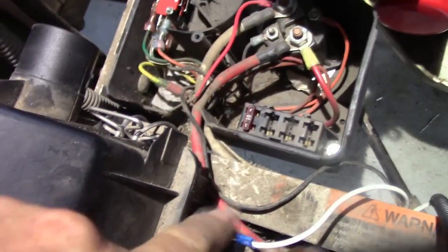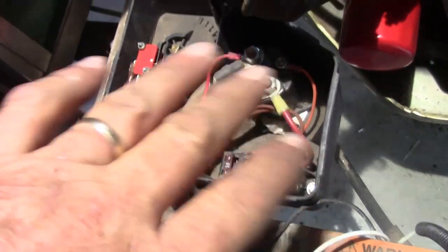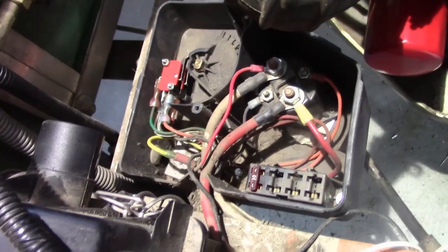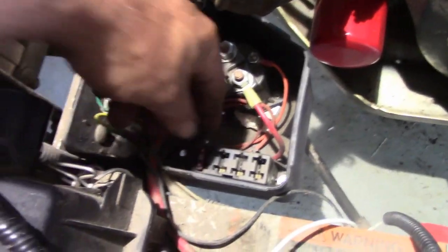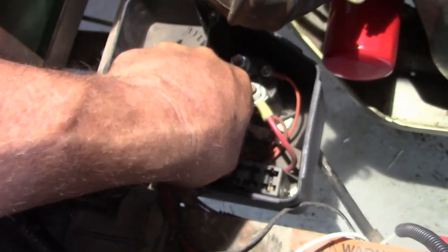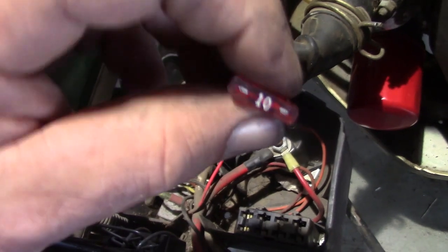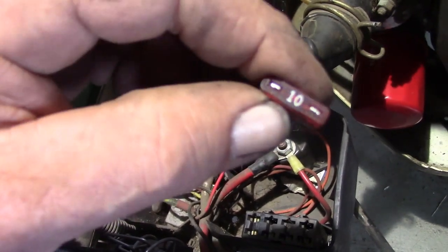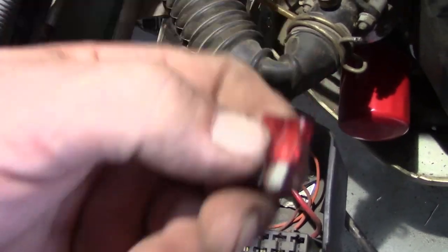One other thing: back to my old ways, I'm not disconnecting the battery cable when working on it because I have to immediately do some tests. But if you want some kind of safety, there's one fuse on these Club Car DSs — it's a 10 amp. You pull that out and that pretty much eliminates all the electrics on one of these golf carts. So that's at least a half-ass safety measure.